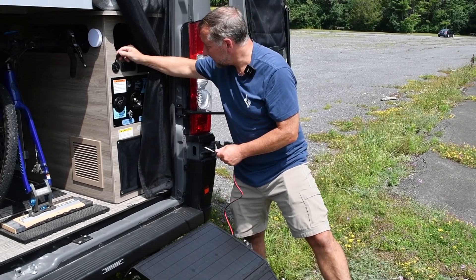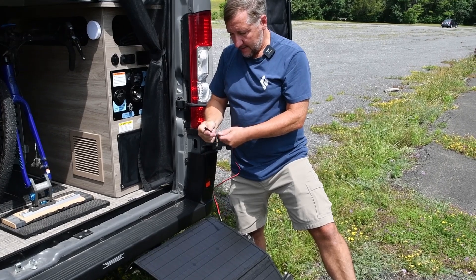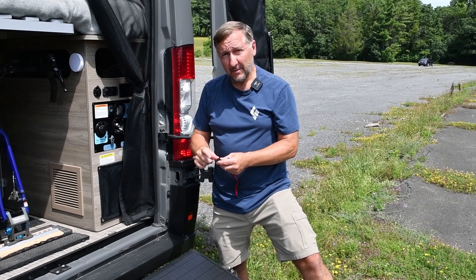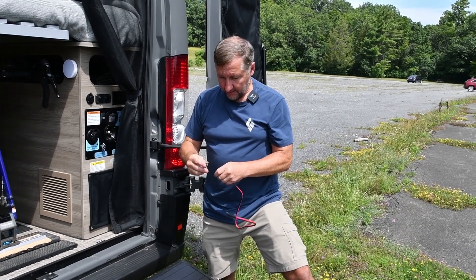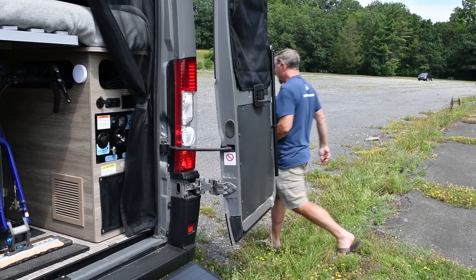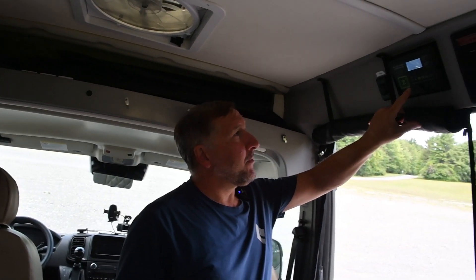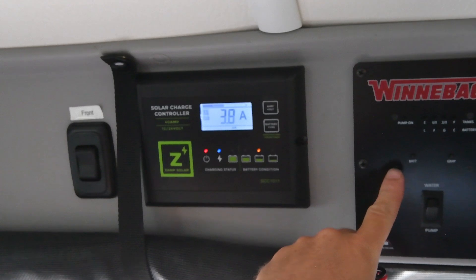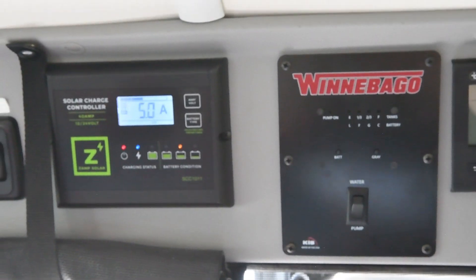So that didn't work — that was a fail. I have read that there could be a polarity reverser. I didn't think we were going to need that, but let's take a look and make sure the main system is still working. Despite whatever happened with the solar panel, fortunately the main charging system is still working. We're in the clouds now so we're down to about 3.6 amps, but it doesn't look like we harmed the van at all. Maybe the polarity is backwards — positive to negative needs to be reversed. Not sure, but something to investigate.